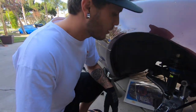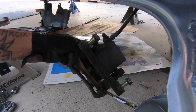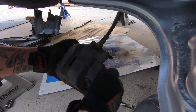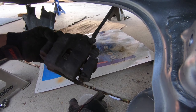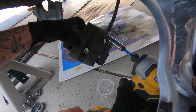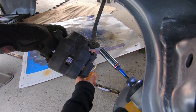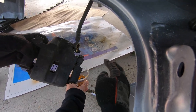Normally your brakes are going to be on your car. These two bolts are going to be on the backside of your spindle — they were 14 mil, so just pop those loose and take off your caliper. Ours are already done, so the only thing we have to do is disconnect the brake line. We've got a little tiny cup right here so any fluid loss goes right in the cup, because this stuff will take off paint. Most of it's in the cup, but more of it's on my hand. That banjo bolt will go in there too.